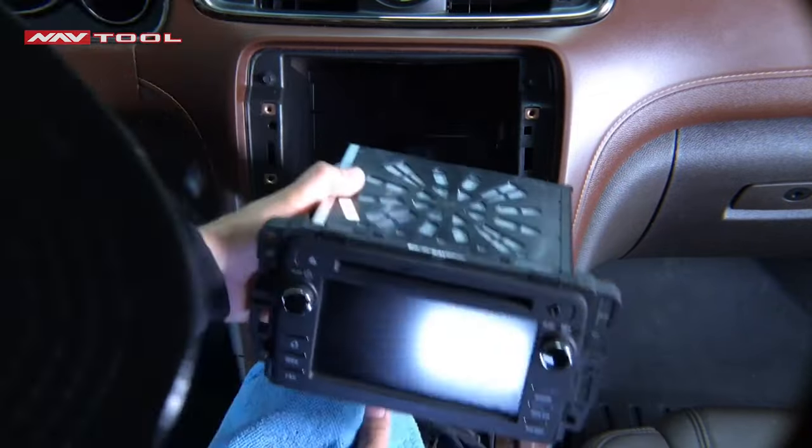Connect the green 4-pin wire to the supplied wire. Make sure both the clip and pin are facing up. Next, connect your red and white auxiliary jacks. Tape them if possible, so they won't come off. Now you can connect the green harness to the interface. Plug the supplied box to the opposite end of the supplied wire.